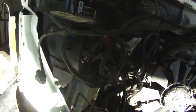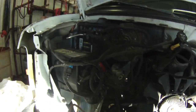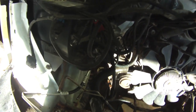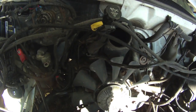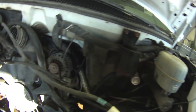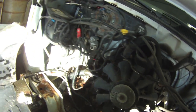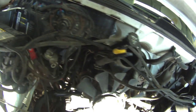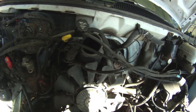What I did was, I didn't have much of a charge in there anyway, so I just released it. The AC wasn't working. I took it off from here and then unclipped all the lines from the rad and the cooler. Now I've got to take off the brake lines here and these back lines too. Going down to the power steering pump — I'm going to take those lines off and let them hang. I'm going to remove some electrical and refer back to the other frame so I know exactly what I'm taking off, because I took a little bit too much off when I did the other one.